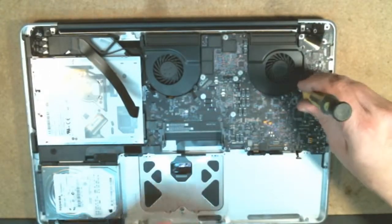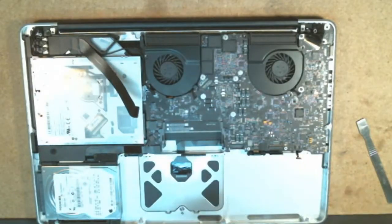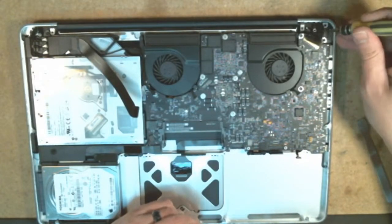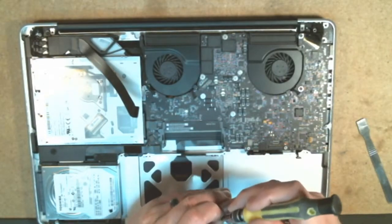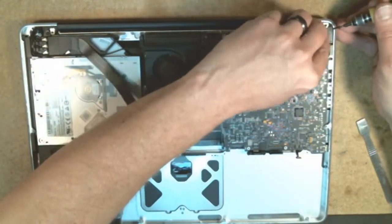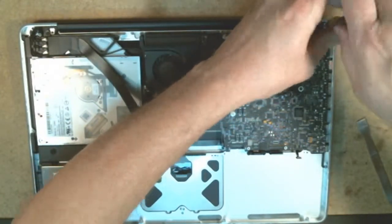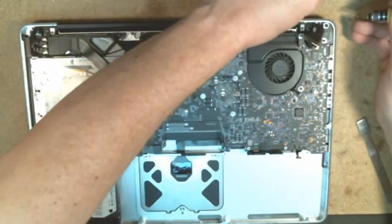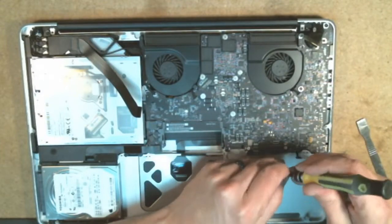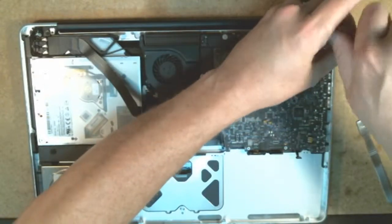The next step in this process is to lock the power supply back into place. The 2 longer screws here, line it up there and make sure that it pops down. When you go to put these screws in, if you have to force them into place, then it's not aligned properly. Keep that in mind. If you put the screw down in there and it twists freely, such as that, it's going into the right spot. Also, it can still be slightly out of alignment, so before you lock the first screw down, put the second screw in, and that will help align everything.